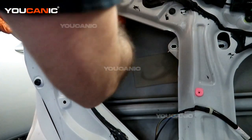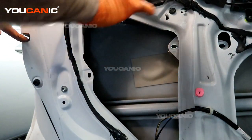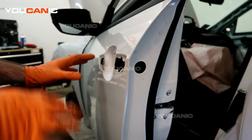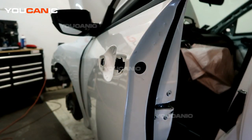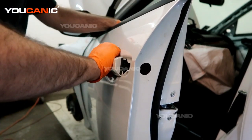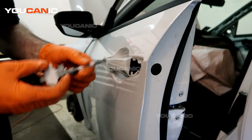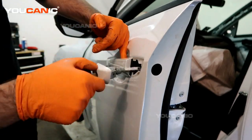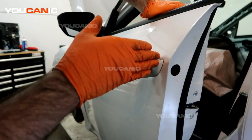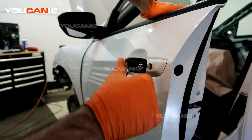Make sure that the window is going up and down and it's not going to interfere with any of these components. Finishing up the components of the door lock actuator and the door handle — we just take our door handle, slide it in, and then slide it straight forward. Then we'll put our door lock cylinder in. We'll make sure we put it in there and that it inserts into the door lock actuator unit. We'll make sure that it works — lock the door, unlock the door.